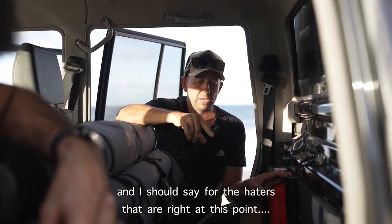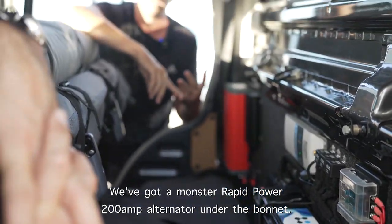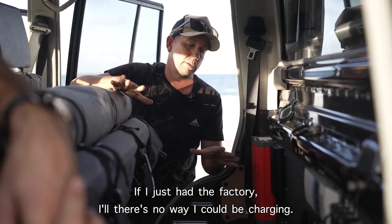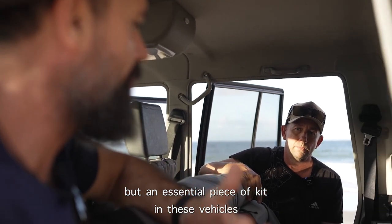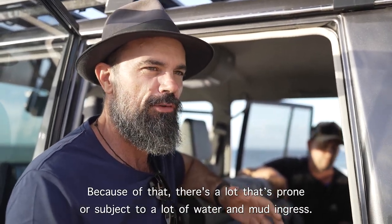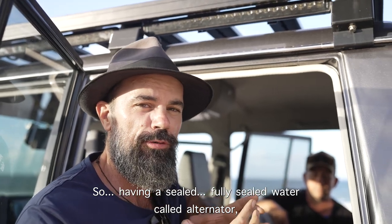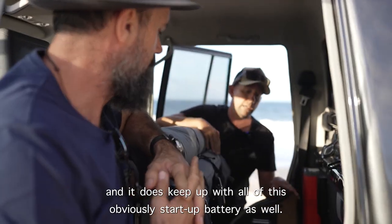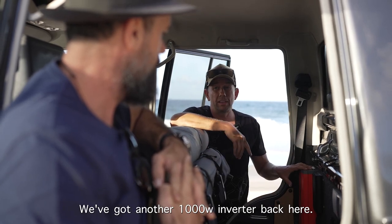This rear battery has another 50-amp charger — so that battery charges at 50 amps. For anyone going 'this is ridiculous, how can you charge so much' — we've got a Rapid Power 200-amp alternator under the bonnet. That's what makes all of this possible; with the factory alternator there's no way I could be charging like this. And it's not just about output — the stock alternator sits in a very low position and is prone to water and mud ingress, so having a fully sealed, water-cooled unit is essential in a 79 Series.